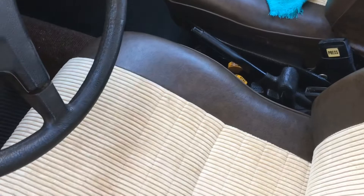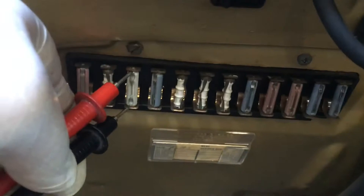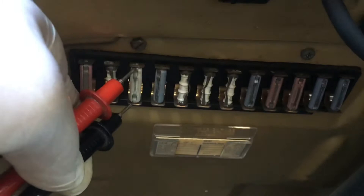The relay is wired into the door jamb switches, the seat belt buckles, and the now-missing seat switches. With the multimeter, I'm just going to quickly check all these fuses to make sure they have continuity — and so far they all do. I believe them to be good. So we've got to take a look in the luggage compartment at that relay that powers the interlock.